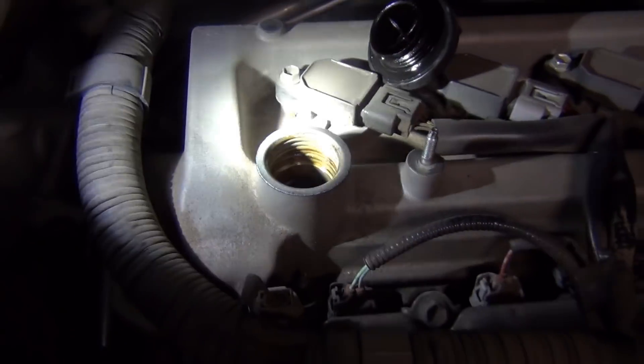If that doesn't work, then I start tearing into stuff. I pulled the hood off and put it over there. I think it's either going to be the alternator or water pump, so I'm going to pull the belt off and then spin those pulleys independently. We've got the belt removed — it's sitting on the floor and the noise is gone. That narrows it down to something in here. Bear in mind, we're running without an alternator and without a water pump, so you don't want to do this for a long period of time. Most cars from cold can run anywhere from three to eight minutes without the belt and water pump before the coolant can't dissipate the heat. When we spin the alternator, it sounds pretty normal. When we spin the water pump, it sounds really dry — it's got kind of a dry roll to it. So in this case, the noise is the water pump.